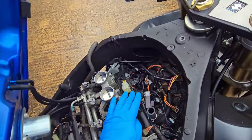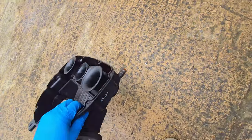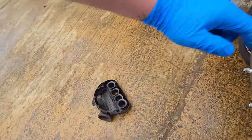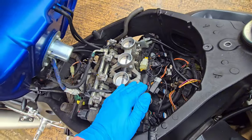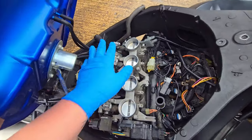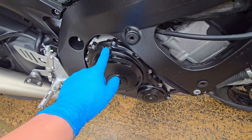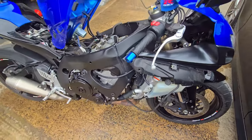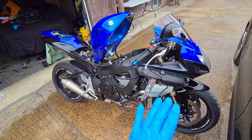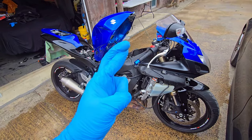The spark plugs are now fitted and everything has gone back together. Before moving on to the next step of fitting the air filter back into the airbox, I want to put some red rubber grease in the internal diameters of the airbox so when I put it back on it looks after the rubber condition and makes it easier to pull off the cylinders next service. I also want to do some general maintenance spraying and cleaning, spray some electrical cleaner into the plugs, top up the oil since the level dropped below the inspection window, and check the coolant.